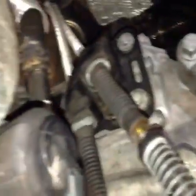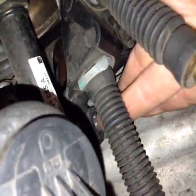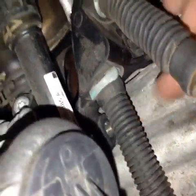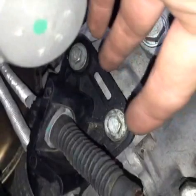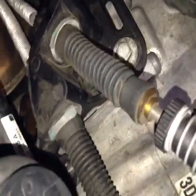There's a bolt or a nut that would go onto this threaded stud here, down here, if you can see where my hand is. This threaded stud here actually holds the linkage onto the transmission. So you have two bolts here that secure it, and then there's also a nut that secures it on the side in order to hold it in place. So that's missing completely as well.